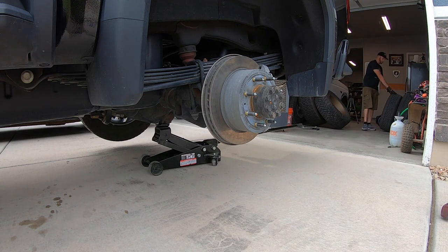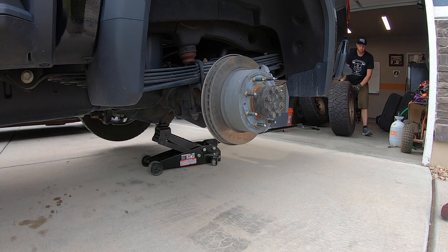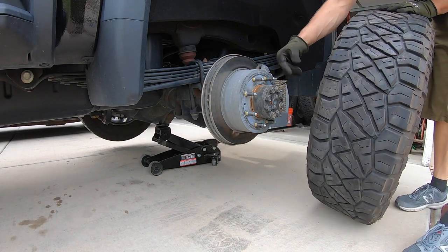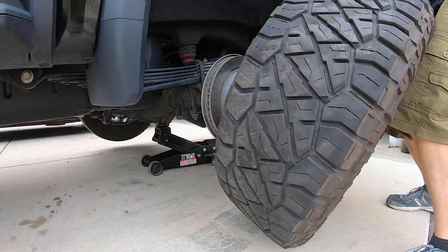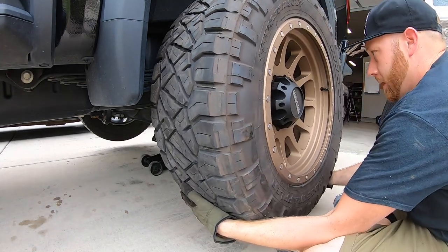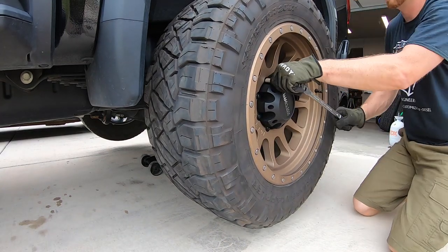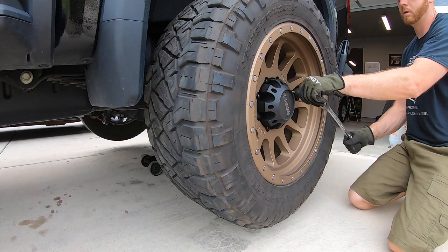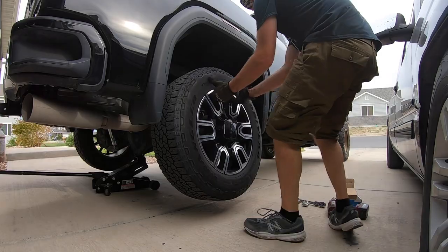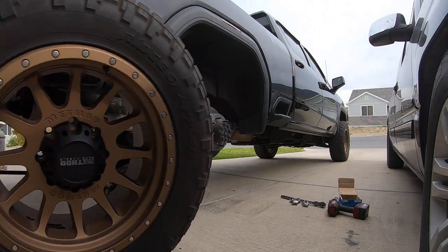Just a quick note on tire pressure — I like to run the stock tires at like 55 to 56 PSI when I'm driving around empty, and it does help the ride quality a fair amount by running a lower pressure. These load range E tires, and especially my Ridge Grapplers which are load range F, even at 55 to 60 PSI they do run a little bit on the stiff side. You don't want to pump them up to 80 — that's really rough — unless you're towing a big trailer. Normally I run them about 55; I'd go a little bit lower if I could, but the TPMS sensors just throw a fit and I hate staring at that tire pressure light.